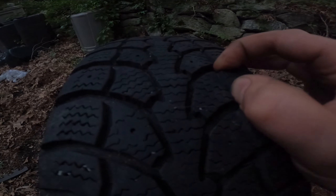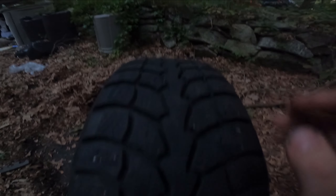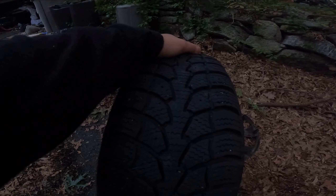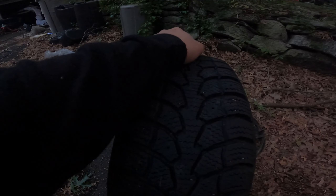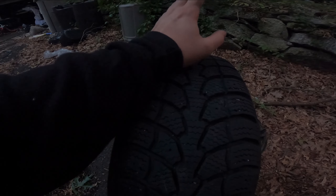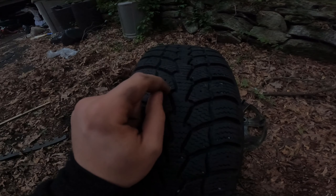Let's talk about the pros and cons of each. Starting with the all-terrain tire: some pros are these tires are super good in loose dirt and gravel — they have very deep grooves to push everything out of the way. They have good grip for rock climbing and things like that. Lower the air pressure, get a little more surface area, and these tires will take you anywhere. The cons: they're very loud on public roads — my Jeep has 31x10.5-inch all-terrain tires made by General and they're very loud. These tires also wear down pretty quickly and don't get the best gas mileage.